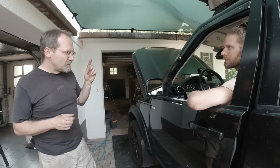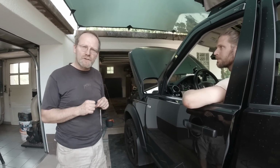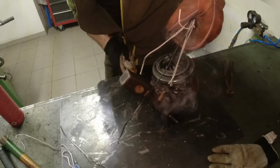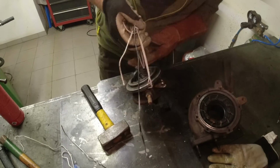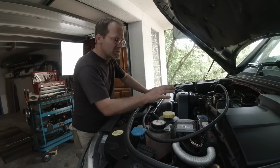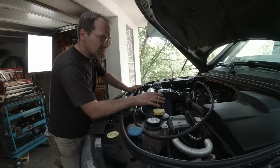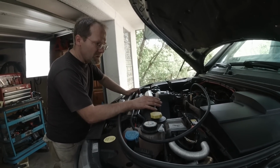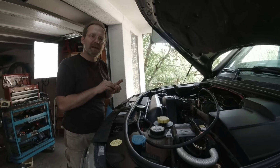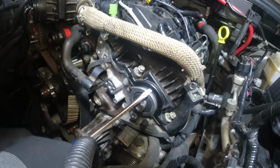The other thing is Fabian is running 5W40 from the day when we rebuilt the engine. This engine also runs this turbocharger where we released the video just a little while ago, actually a 128 euro cartridge installed. This was only a checkup this week because we did fix this oil leak also during his first visit, and we actually found it was the camshaft cover, the plastic cover. Apparently the rubber gasket wasn't seated properly.